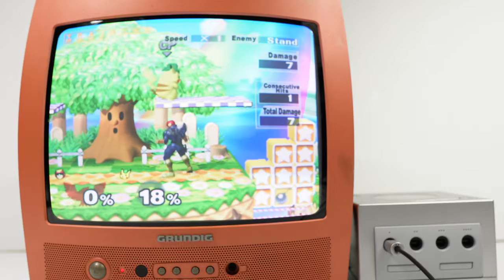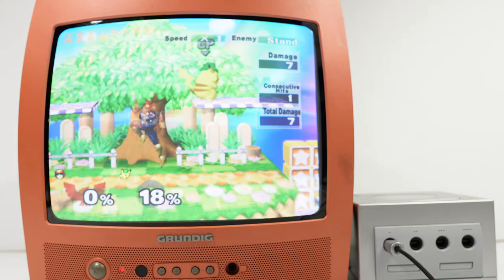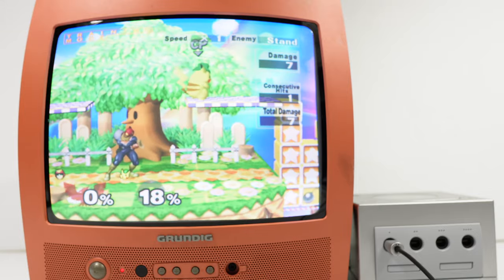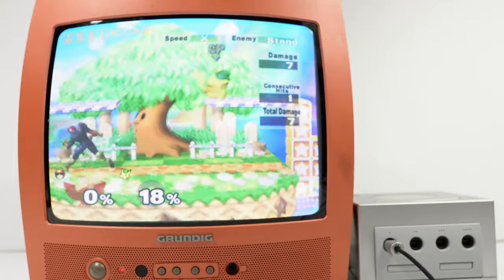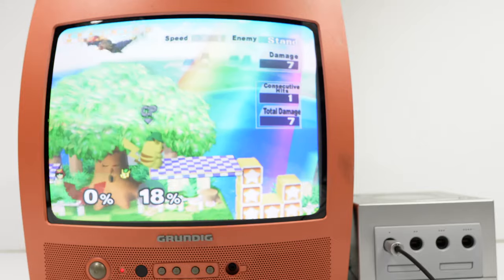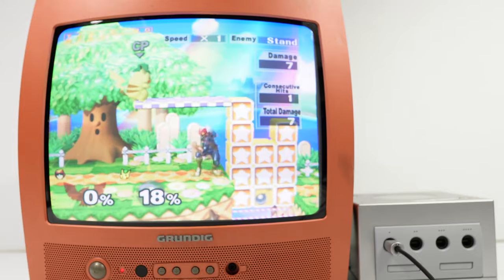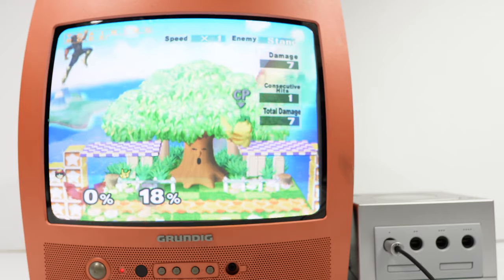To finish off the video: it's not a bad little television. It would be ideal for a Smash Brothers tournament — it's very light, it's a CRT, it has no lag, it has SCART, you can play in RGB, and you can use PAL or NTSC consoles with no problems at all. The one disappointing thing is the lack of geometry adjustment to centre the screen — Grundig were a bit tight on budget by omitting those controls. Otherwise it's a pretty good TV, quite uncommon, but I do recommend it. Since when do I not recommend a Grundig? Thank you for watching. Keep tuning in and see you in the next video.